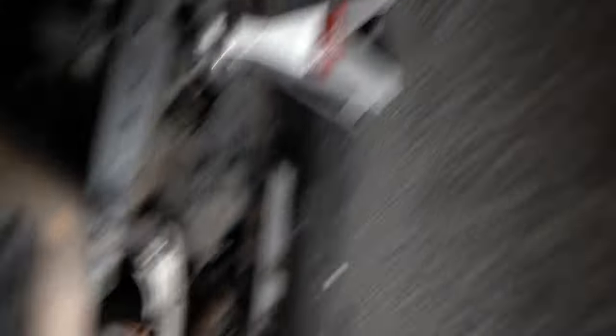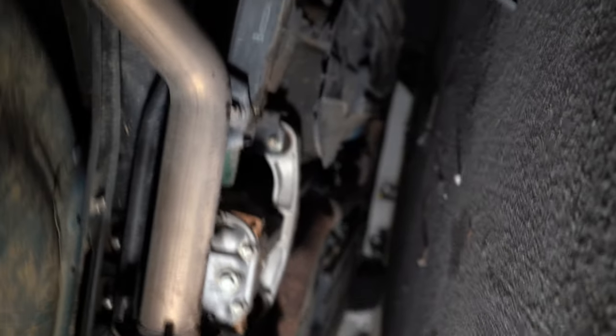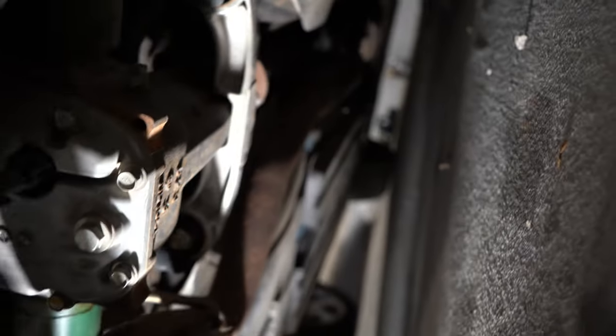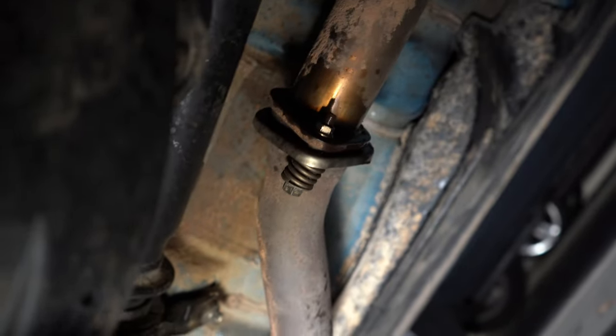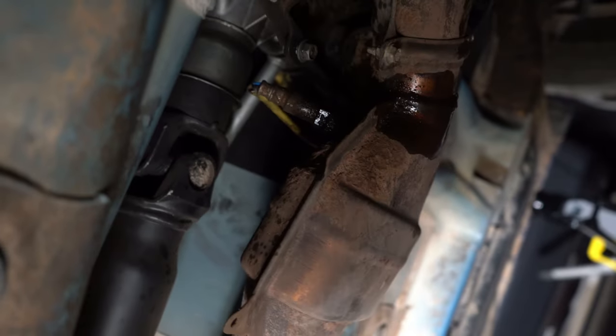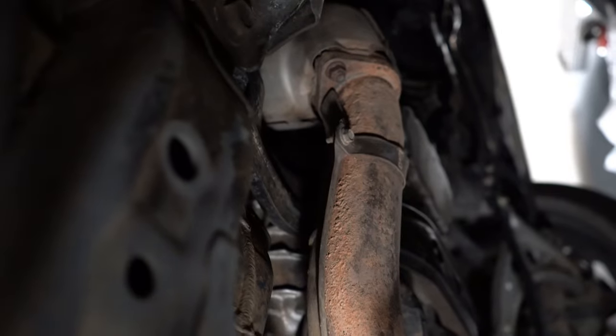Alright, I only went up just a little bit — this should be enough to fit under there and get most of this stuff. I just have to go up to the front and jack that part up with the floor jack. But we're going to work back here first. So you have one muffler and then another muffler right there. You have a lot more room now. There's one more mount for the rubber bracket right there, and then we move up to the front. At the mid part, there are two bolts that connect to the spring on each side — we'll take both of those out and then unplug the rear O2, and then we're pretty much good to go.